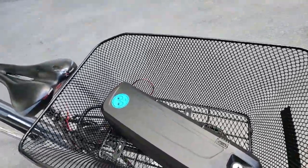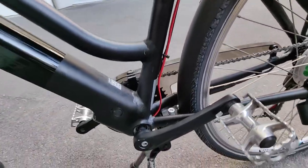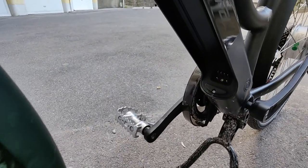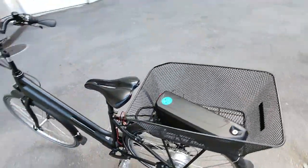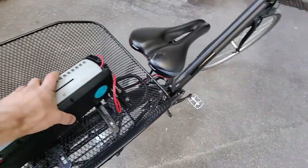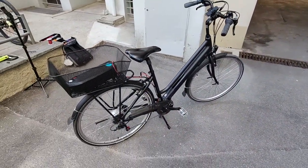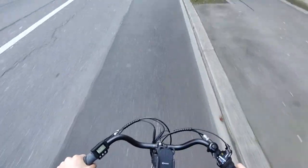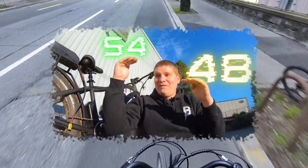This is not a perfect solution for two main reasons. First of all, the original battery housing will stay open, allowing all kinds of dust, water, and debris to be thrown inside from the front wheel. This might already be a sufficient reason not to go for it. But secondly, there's something worse: there's a high risk of frying the BMS - the Battery Management System, the battery controller - in the not-so-remote case where both batteries are connected and turned on at the same time. The reason for this issue is well explained in a great video I've linked, where this guy presents clearly not only the issue but also the right adapter to overcome it.